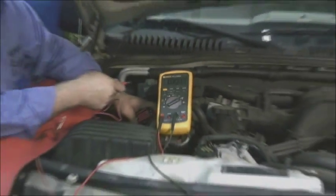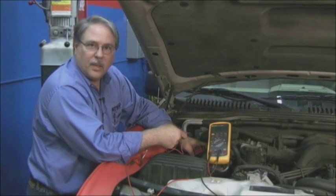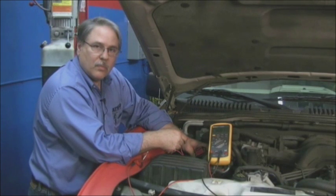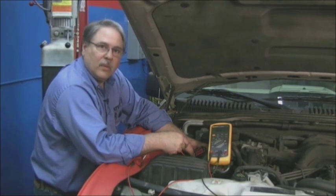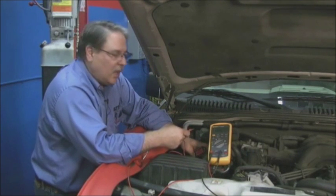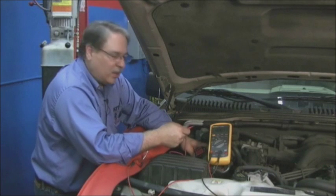What we're actually doing is an actual load test on the entire circuit, making sure that between ohms and volts we're getting the proper current draw. This way we could find a problem with the way the solenoid harness connector is plugged into the pass-through connector on the solenoid block — which, as we saw earlier, can have air conditioning drip down on it and cause issues. And the nice thing about this is that people doing this in their shop aren't even going to take this long. Once you have the right information, this is a lot easier to do.